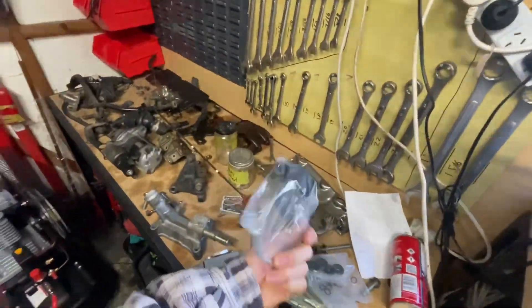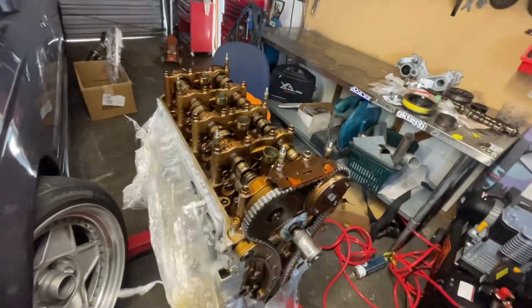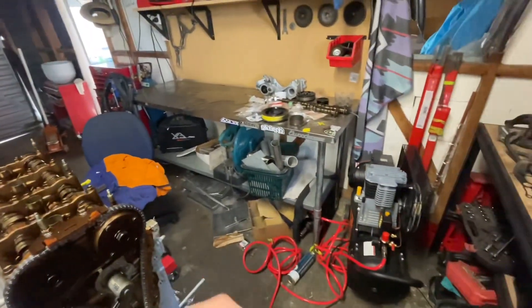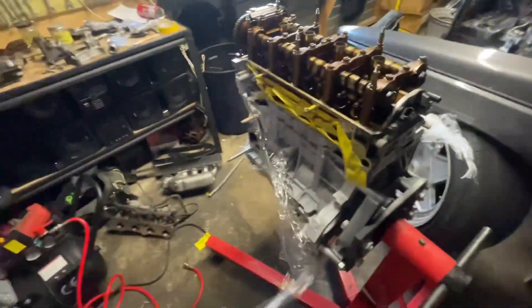It was frustrating, really kicked myself for that. So I stopped and been working on the sump - I'll get into that later. A few more things showed up: got a little dipstick and a dress-up kit to make the top look a little nicer. I put my new timing chain on because I wanted to time it up so I could rotate it, but I'll probably pull that off again and do it properly because I need to put my 50-degree cam gear on. A little hurdle there, a little kink in the road, but such is life.